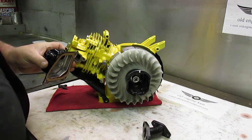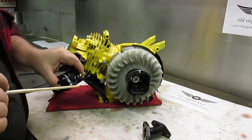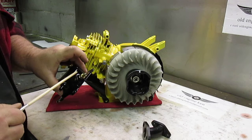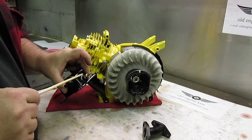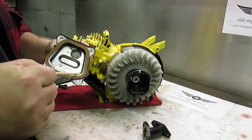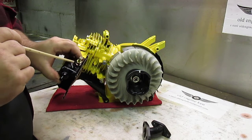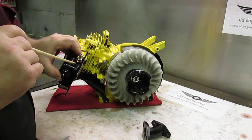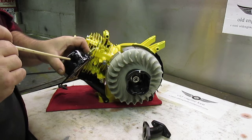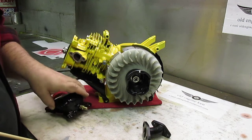I have just taken a regular fitting that I had purchased at an auto parts store, as well as an eighth-inch female fitting that I turned down in the lathe. I drilled the hole through the valve cover on this side, then simply soldered the female eighth-inch pipe fitting into the top of my valve cover. I also took another fitting, turned it down in the lathe, and soldered it here for my blow-by tube.